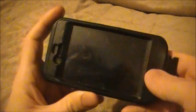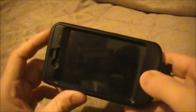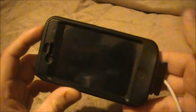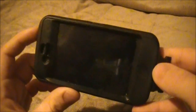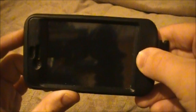Your device is in DFU mode — it's that simple. Now to get your device out of DFU mode, this requires a little more thought. What we're going to do is press the power button and the home button for about seven seconds. After that, we're going to release the home button and keep holding down on the power button until the Apple logo shows up on our screen. Trust me, you will know when it's out of DFU.